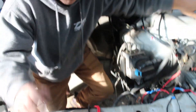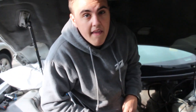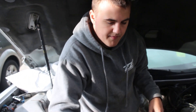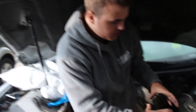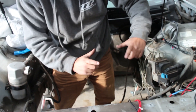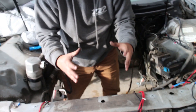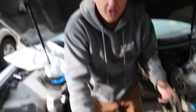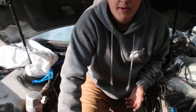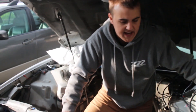The meth kit needs to go about 8 inches from the throttle body, or it might have to go 8 inches from the supercharger inlet — I might have to read the instructions. The throttle body should sit right here, so we're thinking maybe a 90-degree bend, then some mild steel, and another 90. Then maybe reusing the stock air box — not sure if we're going to do that. I might get like the SLP cold air dam.